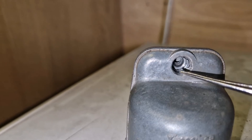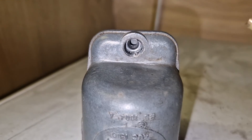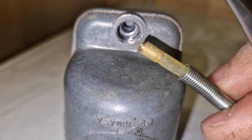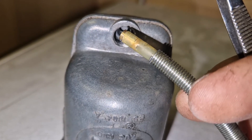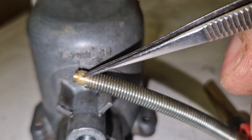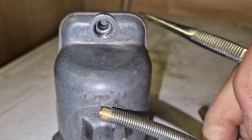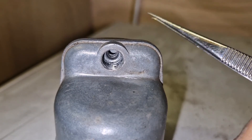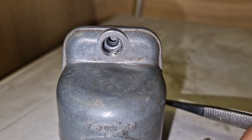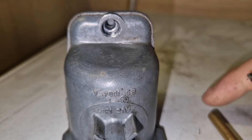You can see where the rubber fits down into the hole, then it's compressed by that silver washer, which fits over the top of this pipe. The pipe has a brass insert inside — it goes in the hole, and the steel washer presses the rubber and squashes it around to seal onto the pipe, with the outside of the rubber sealing around the bottom. So that was a big waste of time trying to sort the seal when in fact it was a cracked float bowl. I've now got a replacement float bowl — exact same part number — and fitting that has solved the problem.